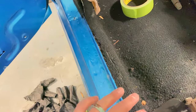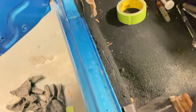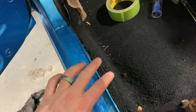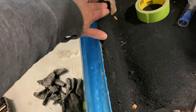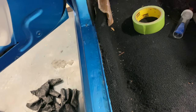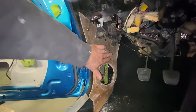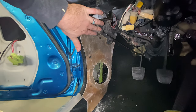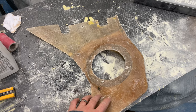Tech tip: I cut too much off here when I was putting the carpet in — it was a challenging carpet install. What did work to reattach it is Permatex Ultra Blind Super Glue — that stuff is holding together quite durably. For anyone who makes the same mistake, put a little bit of carpet dye on those spots and it'll look a lot better. I've got the driver's side kick panel almost mounted — keeping the original piece because the fuse block and flasher mount to it, secured with a screw here and here.